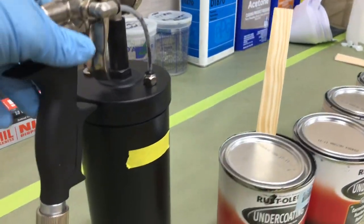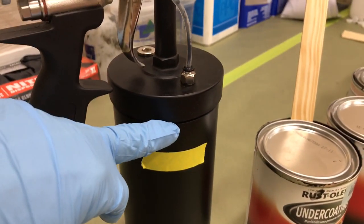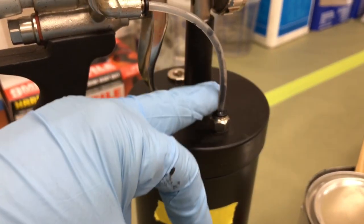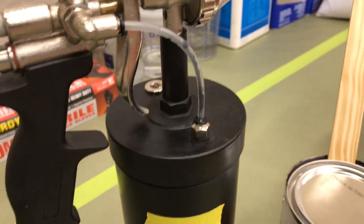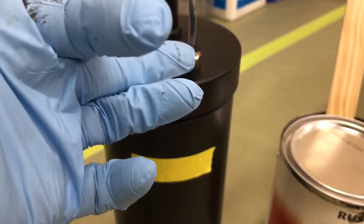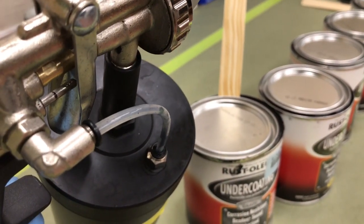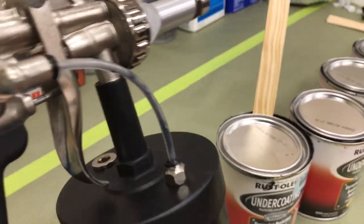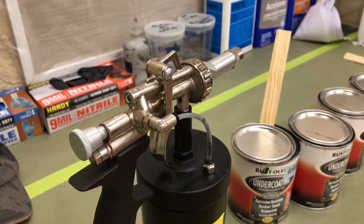When I fill my gun, I've got a piece of tape on here. We don't want to really fill the gun up because you could run into problems while it's spraying. Right here is our siphon tube, and this needs to breathe — it takes the pressure out of the gun as the material is draining down. If we get material in this, it'll stop spraying. If you're tipping the gun sideways this way and you take a drink of material, it'll plug that. You can lean the gun one way, but not the other, so be careful how much leaning you do with a full cup.